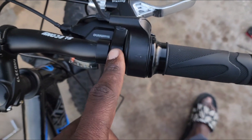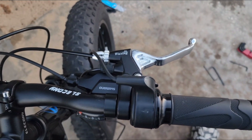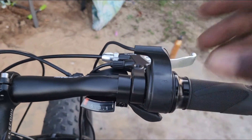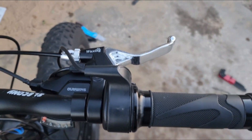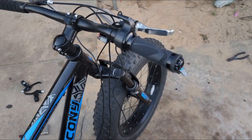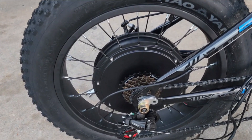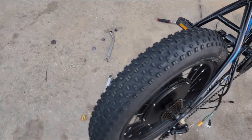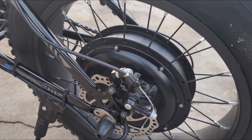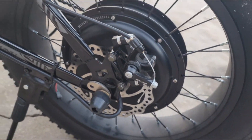I swapped them around — we've got the brake before the throttle and the shifter before the brake, and that's perfect. He can still reach the shifter with his little hands and the brake is in reach — that's the most important thing, that he can press the brakes when he needs to. All in all it's looking real good. And believe it or not, it's a 1500-watt motor but it looks almost like a 3000-watt — it's a pretty big hub motor for 1500 watts, by MB Power.